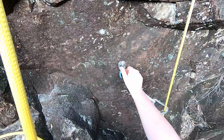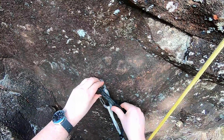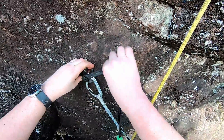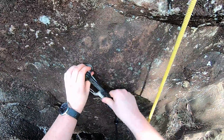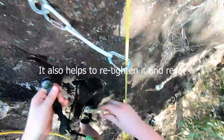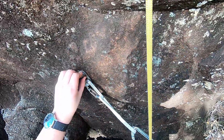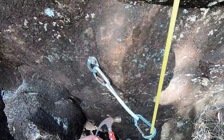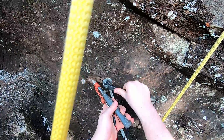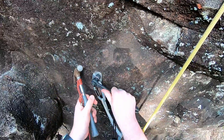This one is loose — it may be able to tighten though. I think it's actually seized. Okay, so it's a spinner, so I've got to put some outward pressure on it, and that way it'll have some resistance to the bolt turning on the inside. It's coming in a bit, which is nice — basically means that it's not just spinning around inside the hole.